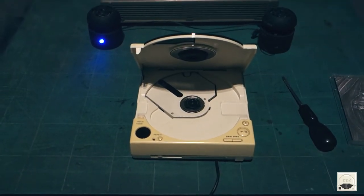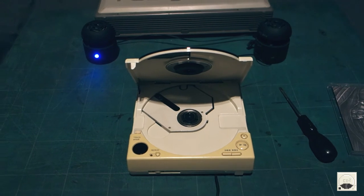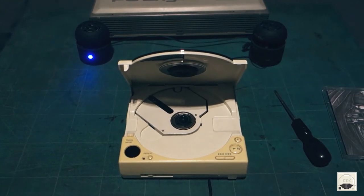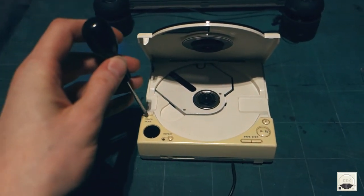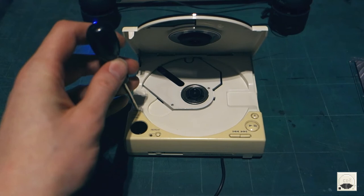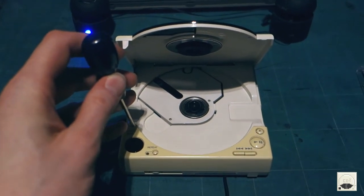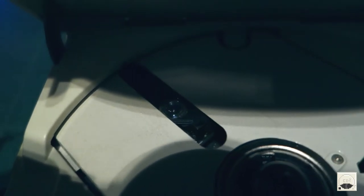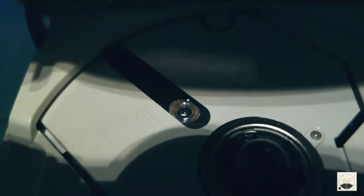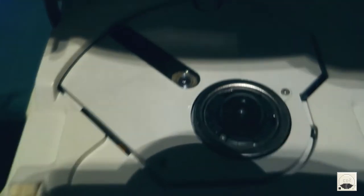I was having a little fiddle with the lens array just with the screwdriver, moving the lens backwards and forwards gently. And if I pretend to put a disc in and I press the play button, which I'm going to do with my camera hand, I'll quickly try and focus — the laser moves. See the laser moving there. And then the spindle spun.